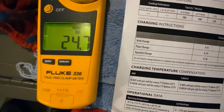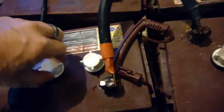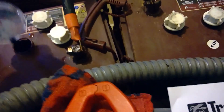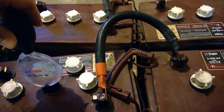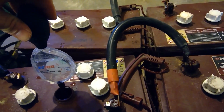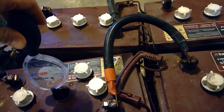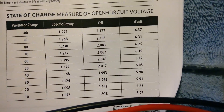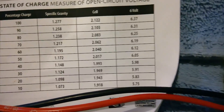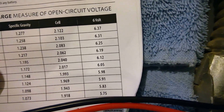I'll also try to do a specific gravity test here with one hand so you can see it. The first one's right around 1.225. If we come over to 1.225 on the specific gravity chart, the closest thing we can get to here is about 70% — you know, 1.217. Those meters aren't that accurate, but it's close enough for what we're trying to prove here.